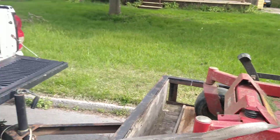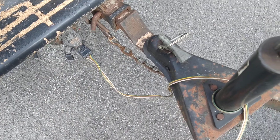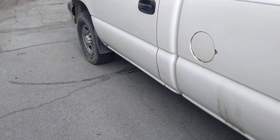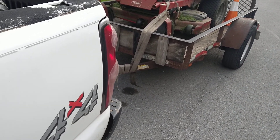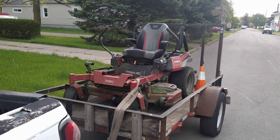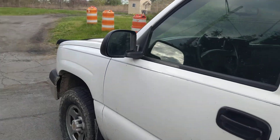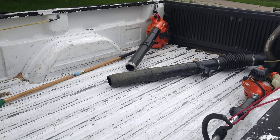All I'm trying to do is get to the person's house and get the job done. Make sure you've got your safety chains on and your hitch receiver tight, because if you get pulled over for some reason — also make sure you've got your trailer registered. That's an easy ticket. Whatever it costs in your area, it's a lot cheaper to pay twenty or thirty bucks for the year than to get a ticket, have to go to court, still pay the fine, and still have to register the trailer. You're not gonna win.